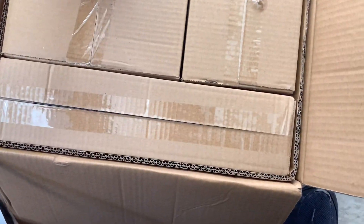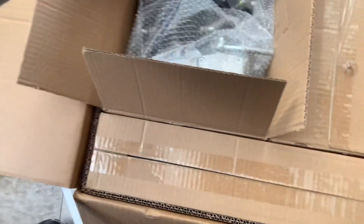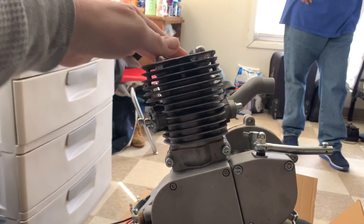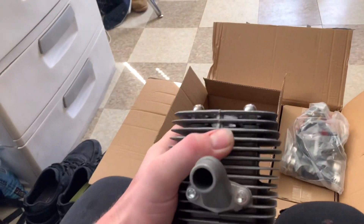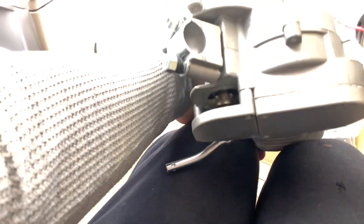Let's go to the big one because that's the only one we care about. Oh boy, there she is. Look at that - ourselves a new 100cc. Very nice, very nice - eight millimeter studs, all allen head, very good. 40 millimeters stroke, intake and exhaust, we're good to go. No cracks visible.